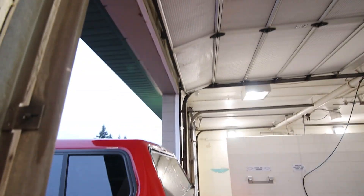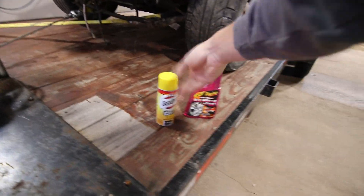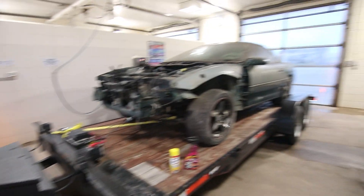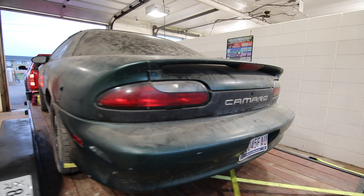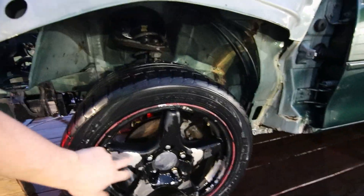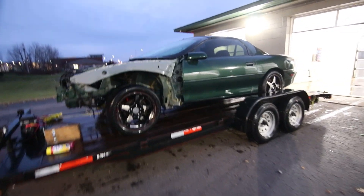Alright, I've got some products here — wheel and tire cleaner and oven cleaner for the engine bay. I'm gonna clean this up really well and hopefully we'll know what we've got to work with. The paint's not gonna be the best but it'll be clean. All around here it's filthy — full of cat paw marks, dirt, grime, years of dust like it was in a barn. I got the car all cleaned up. The wheels appear to have probably been polished at one time — this might just be plastic dip on it, so it'll actually probably clean up and go back to their silver finish.